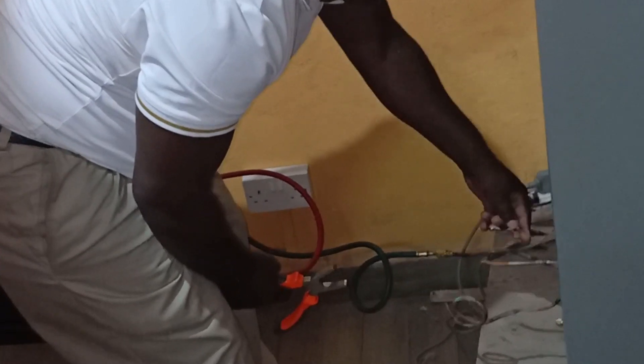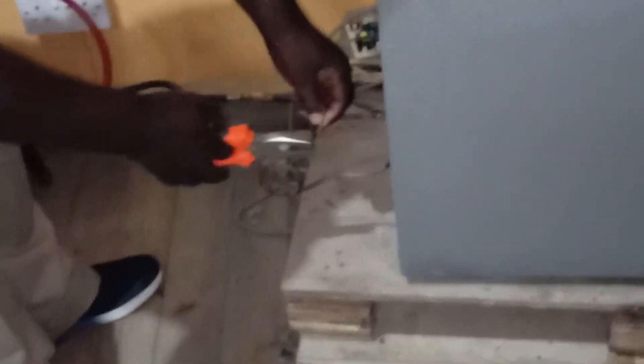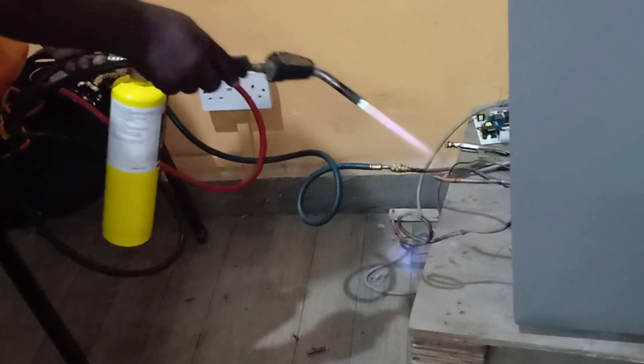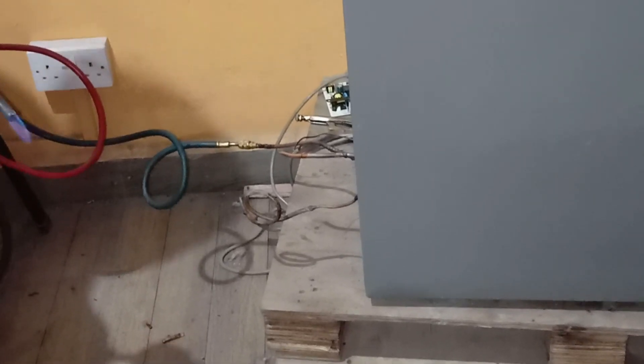I've decided to use a reverse cycle for pressure testing the system, because I'll achieve more gas via the big pipe than via this small pipe. I want to release this gas via this small pipe and it will come out. I want to use the torch to prove that the gas will come out — and all you can see is the gas I'm referring to. This is the difference. I can state confidently that this leakage is between the suction — the bigger pipe — to the evaporator, or between the small pipe, this capillary, to the evaporator. Because this bigger pipe comes and enters here, and this is the accumulator, to accumulate more gas. We've tested with the map gas and the torch method, and there was no leakage externally. So the leakage is between here and the body inside.